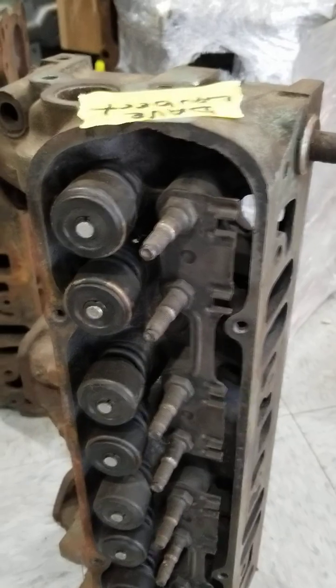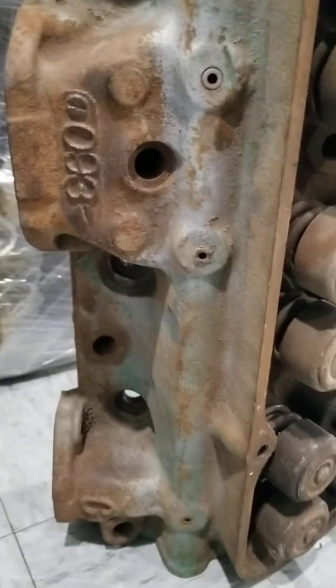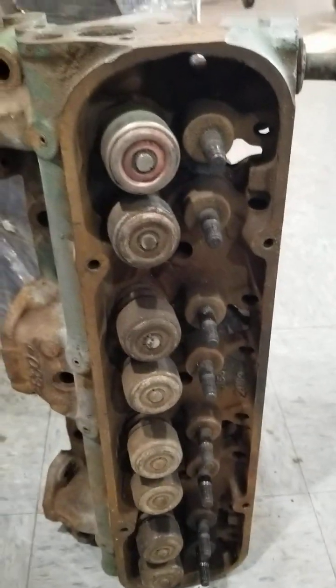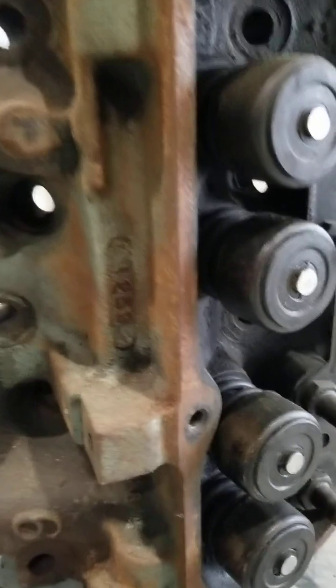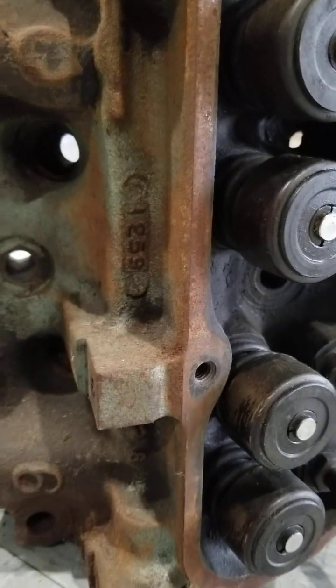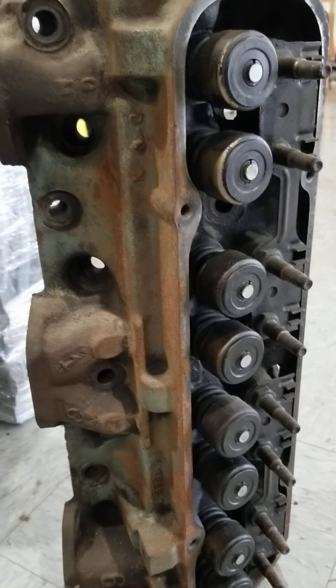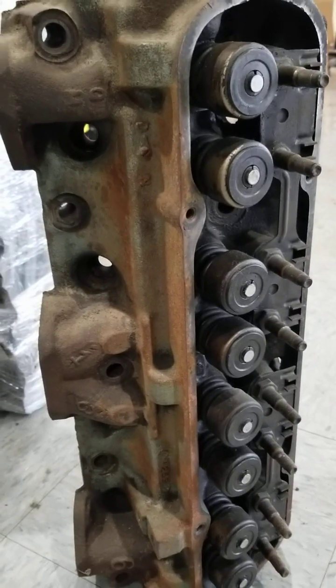I just wanted to give everybody an idea of where to look for cylinder head casting numbers. This one here looks like an 093 head — this cylinder head is actually a 1966 389 cylinder head. This casting over here is number 13, and this is a 1970 head — you can probably see the casting date there. This is a 1970 number 13 head, which was pretty common for 1970 400s with automatic transmission. It was the high-performance, high-compression head with 211 and 177 valves.